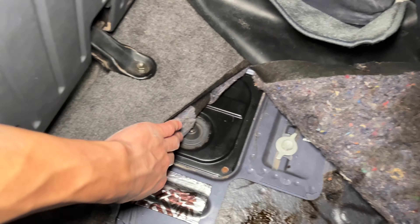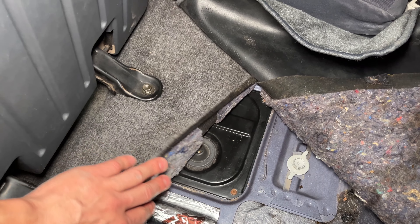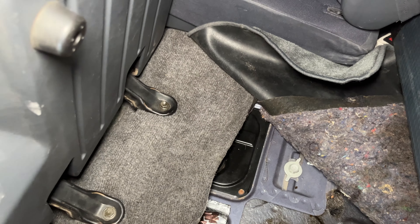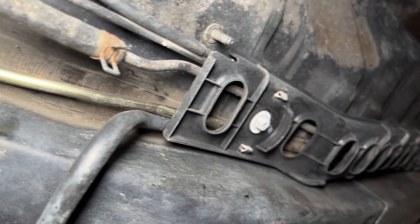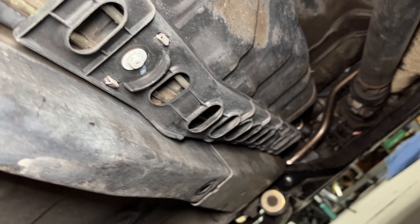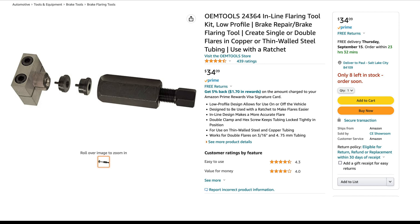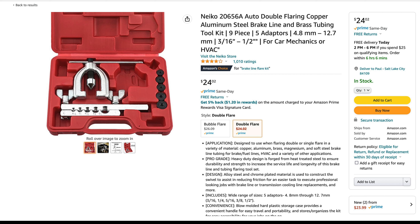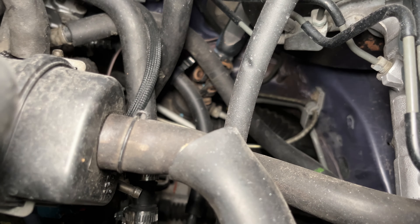With the 3SGTE, you need a different fuel pump. It's located under this cover under the back seat. You can get the fuel pump out from here, but you still have to drop the tank to add a fuel return line. This line just runs from the gas tank to the front of the car. Dylan used a quarter-inch brake line tubing kit from Amazon. I also recommend using this style flaring tool — it's cheap and works really well. Don't buy this weird clamp one; it's trash and doesn't work. Here you can see the fuel return line in the engine bay.